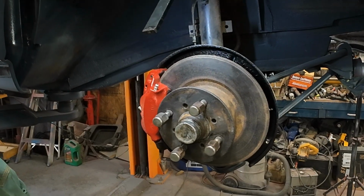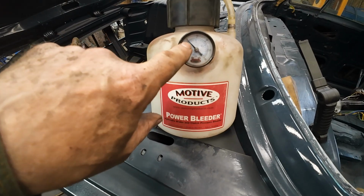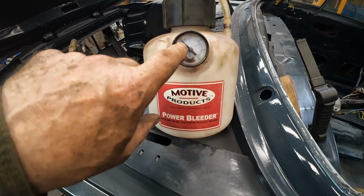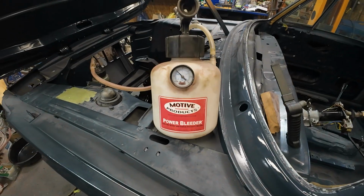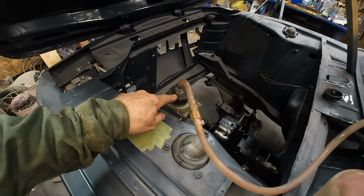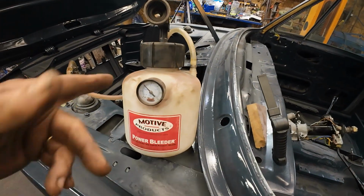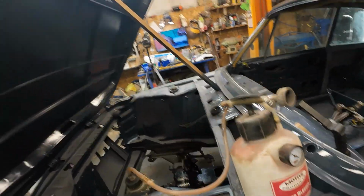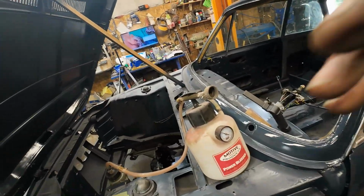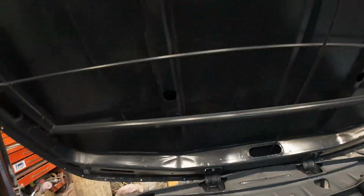I'll go do that and then I'll see if there's a breakdown. So I'll just wait a few minutes and see if the pressure drops any in here. Then I'll know if something's leaking somewhere. Well, it likely is. It's leaking a bit. You can see it bubbling, and that's likely leaking at the top of this thing here, or somewhere in one of these joints. So that's completely pointless watching that because it's going to drop. Okay. Anyway, I'll unhook everything. It looks like the reservoir is full to here somewhere, which is close to the maximum size, and that's great.